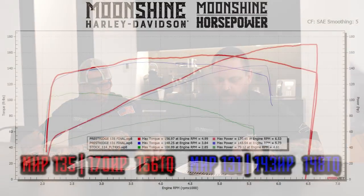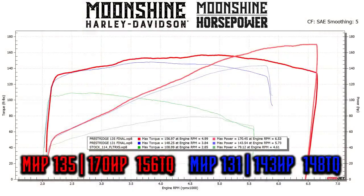So after we built the 135, we kept his exhaust. We went to a different intake manifold, but the exhaust and all that was the same. We kept his cam plate and all that. We switched out — had the case bored, did the 135, different heads, different cam. And if you look now, it just came alive: 157 foot-pounds of torque and 170 horsepower. That bike was a lot of fun to ride. Yeah, it was a lot of fun to ride.